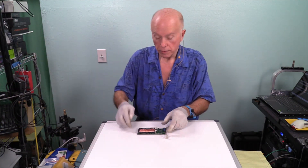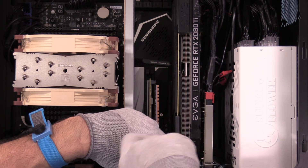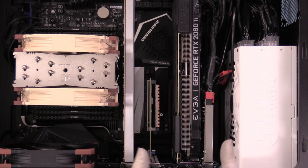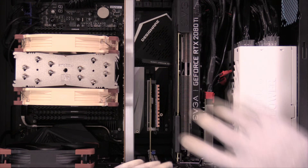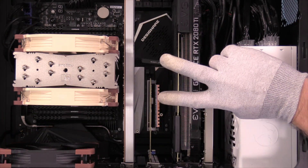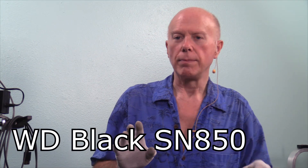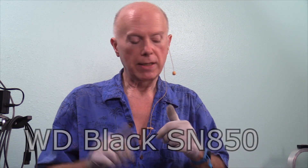All the anticipation! We need to get this in the box, in the first eight-lane slot. Card is secure in the slot and the bracket is secure. Our test platform is a Gigabyte TRX40 Designare with two 16-lane slots and two 8-lane slots. In the primary 8-lane slot, bifurcated in the BIOS to four lanes and four lanes, we have two M.2 NVMe drives on the Supermicro Dual M.2 NVMe adapter. The primary drive we're going to test is the WD Black SN850. We'll go into Windows, identify the drive, look at telemetry for heat via the thermistor, look at speed, and watch our minimum, maximum, and average.